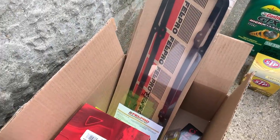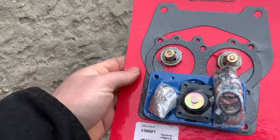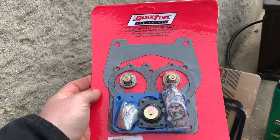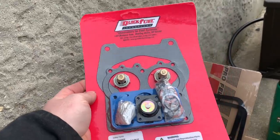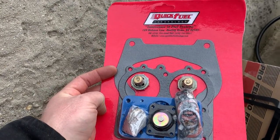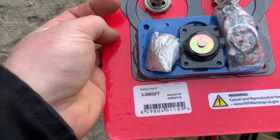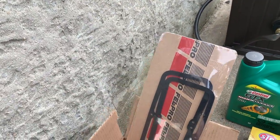Over here is the actual kit. I got this off eBay. I had some trouble finding a kit for this carb because it's a factory replacement Holley - it's literally a spread bore aftermarket Holley carburetor that's a factory replacement for the Quadrajet. I was looking around and couldn't really find a rebuild kit for a reasonable price. All the ones from Holley were like $100 or more. I found this on eBay for like $40, and it does fit my carb - I have the 4175. It is leaking some gas, so who knows what else might be wrong with it. I figured why not.